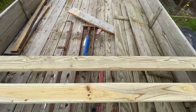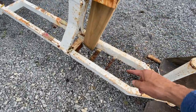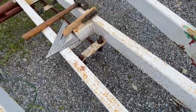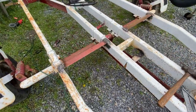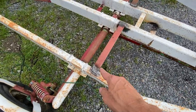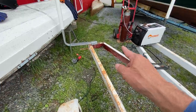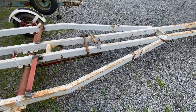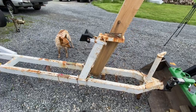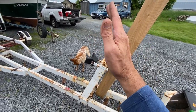We'll launch it another Thursday. We've moved that whole system — it used to sit up here but it twisted the axle, so these bars came back here and we've modified it to attach here so the axle won't twist. That's how you could adjust the height of the trailer, by the axle pivoting, but now it won't do that. We've added these pieces here and they're going to hold adjustment for the bunk. There'll be adjustments for the bunk in multiple spots. We still need to figure that out. Next project is to build a higher winch stand at this angle, and it will also have a turnbuckle so it moves this way so you can adjust it.